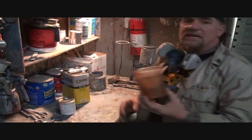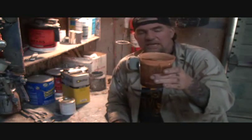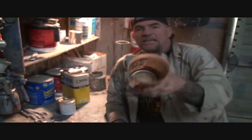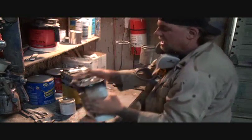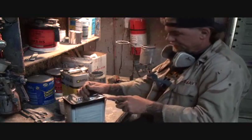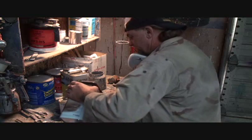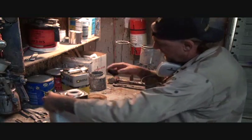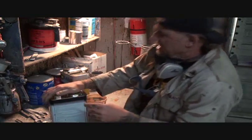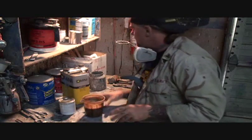The first thing you want to do is: we mixed our paint up in this cup right here, then I went ahead and poured it back into the can of paint when we were done. But I kept the residue — that's an important step. Next, we're going to get our clear coat and mix up enough for two full wet coats of clear. I added that clear to the paint residue, because that's an important step to make sure that it mixes. You might be looking at it and saying it's going to be brown on the car — not really, if you look right here it's very, very light and transparent.